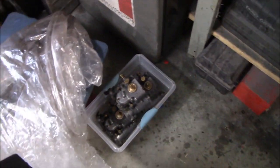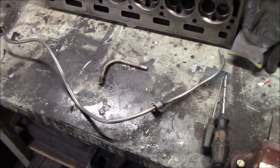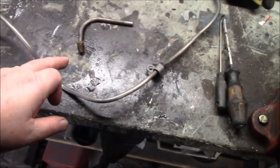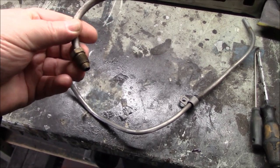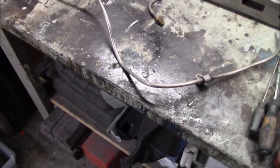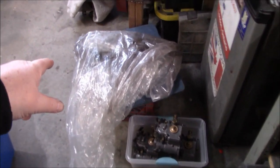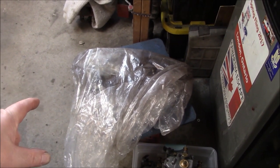Today is carb day. I've got the triple Webers here and we'll bring them up onto the bench and have a little discussion. The next thing I'm going to do is install the two hard lines — the entry and exit from the actual fuel pump. A soft line will attach to the entry, and the exit runs up to the soft line where it enters the Weber carbs. We'll go ahead and install those on the car just to get them out of the way, and then we'll have our chat about the Webers and break out the bag of bits showing the linkages and mounts.